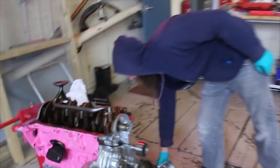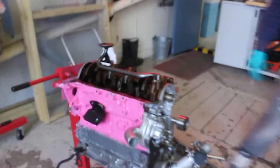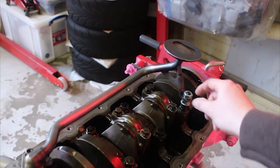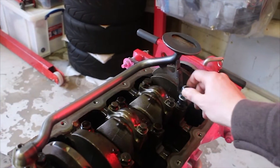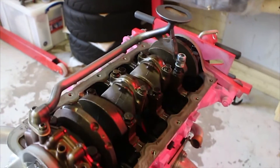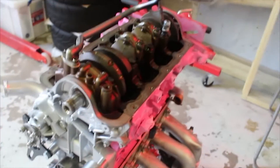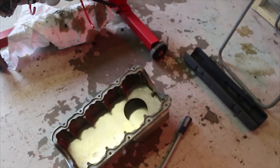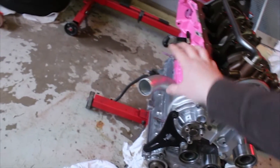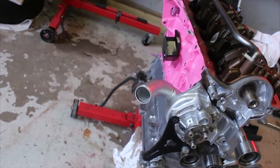We have painted it, as you can clearly see, in a very leery shade of hot pink VHT engine enamel. We've also been fiddling around trying to get the oil pickup system to work, which involves having to space off the mains cap bolts because the silver tops are different to the black tops. Once we sorted that issue out, we refitted our G19 engineering sump and modified the water pump outlet so it clears the exhaust header on primary one.